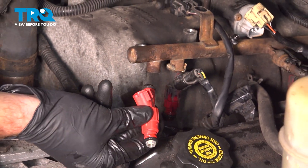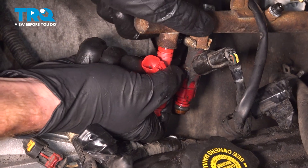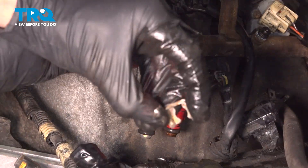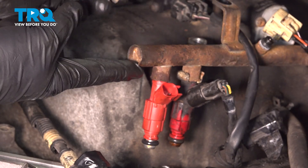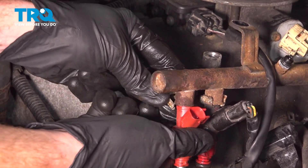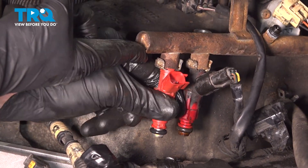Now we can take this and put it in place, right up inside that fuel rail. Once you have it up in there, continue on with your locking clip. Sliding this in can be a little bit difficult sometimes — you'll just have to work it around until that seal makes its way up in. Let's double check to make sure it's completely seated, put it in the proper angle, and we can put in our locking clip. Make sure you have it in the right position. Come in along the backside, along the intake, and slide it right on in. Double check to make sure the fuel injector is completely seated. That feels nice and tight.